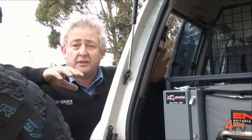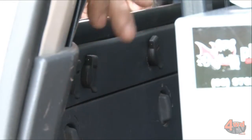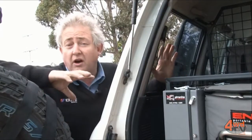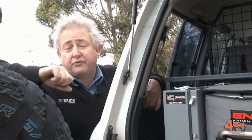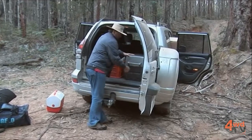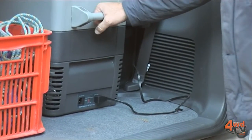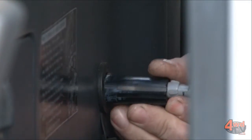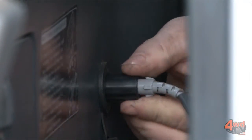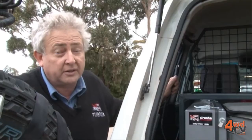In the back of this car we have an assortment of different plugs and sockets — three merit sockets wired live all the time off the auxiliary battery. The one up the front is for your fridge, and that's wired via a low voltage cutout, so it actually shuts the fridge off at a predetermined threshold. That way it's not likely to damage the battery or the fridge. One of the greatest problems with four-wheel drive electrics is people saying the fridge has stopped working — in most cases there's nothing wrong with the fridge or the car's electrics, it's the plug and socket. We never use cigarette lighter sockets for fridges; driving for eight hours in the back of the car, it's going to be eight hours before you realise it's all gone wrong.